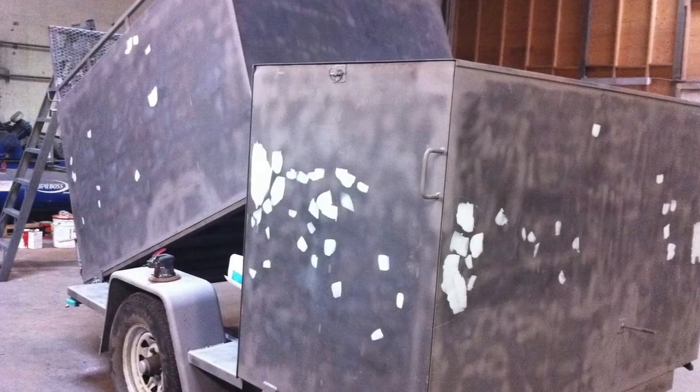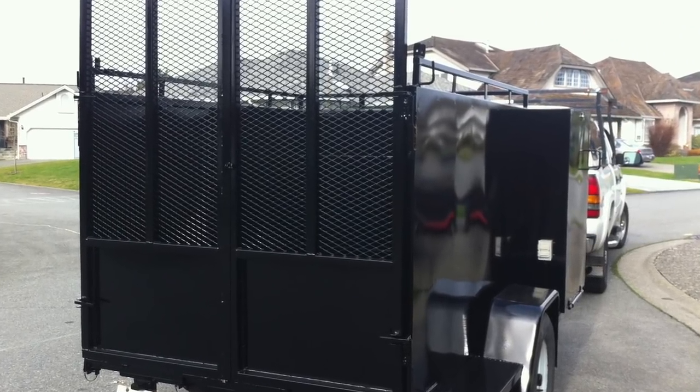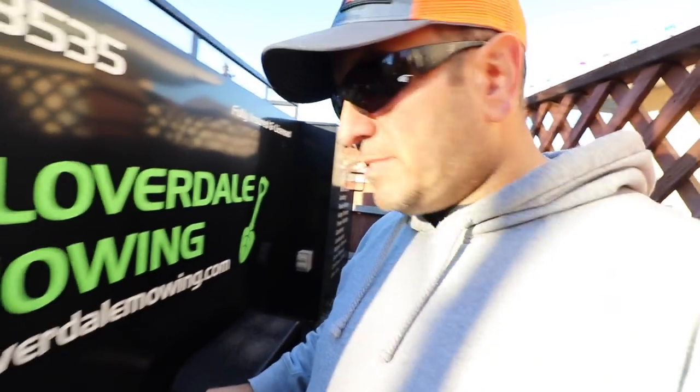When I left the franchise and decided to go on my own, I took the trailer to a truck refinishing shop. They sandblasted it completely right down to bare metal, removing all the decals, all the paint, and any rust issues that we had on the trailer. They completely refinished the whole trailer with an epoxy primer and repainted it with this urethane enamel. I think they told me this was an aircraft quality grade enamel, and it's held up really, really well. So it was specifically an industrial type paint. And then of course I did all the lettering myself, as I own a sign machine.